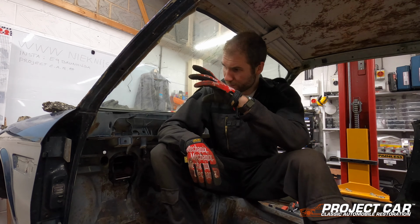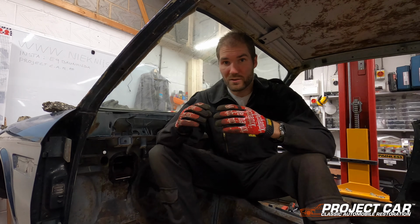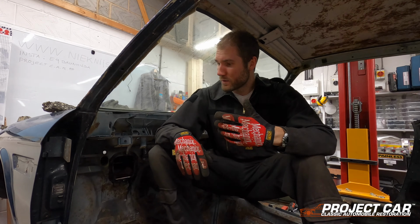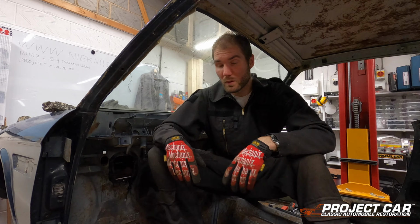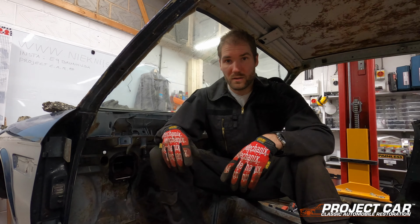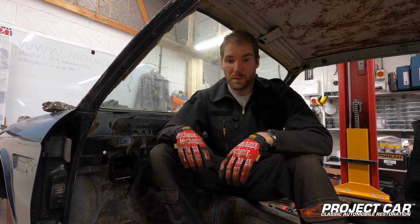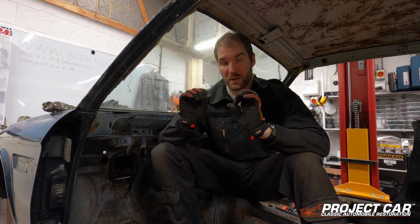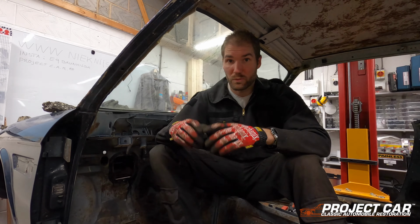But first off, we'll have to make sure that the rubber is loose, it's not stuck down with anything. The amount of sealant I found on this car so far doesn't bode well, but hopefully we'll get that out pretty quickly. Once we've checked the outer seal, we'll start gently folding back the rubber on the inside around the body frame. Hopefully that will pop out without shattering the glass. So fingers crossed it won't, and it'll be a straightforward job.